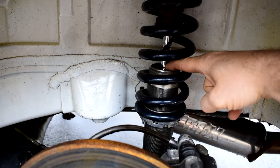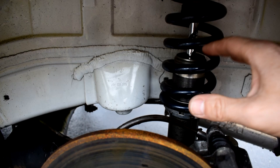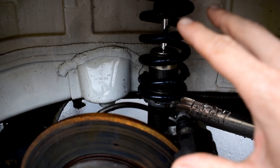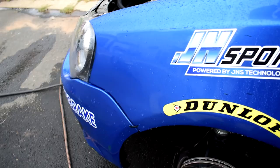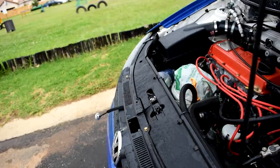The same goes for your shock absorbers. So don't sit with the hose pipe and spray into the seal of the shock absorber, obviously, because then you're going to penetrate the seal with water, especially if you're using a high pressure cleaner. So just keep the cleaner at a fair distance to spray off the residual dirt in that once the detergent's done its thing. So just be conscious, use your brain, and try not to spray too much water into critical components. Same with the CV joints, bearings, electrical components, and the like.